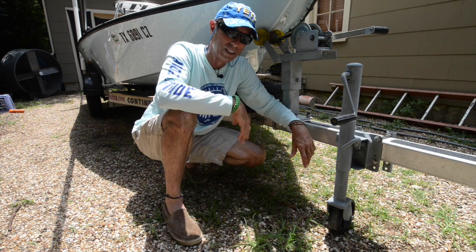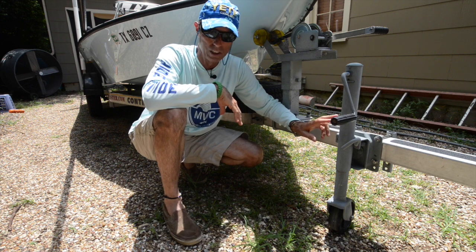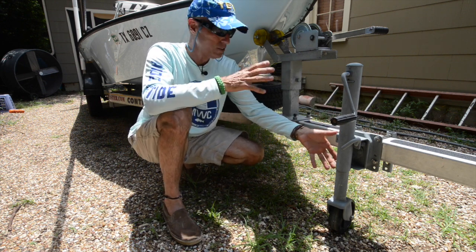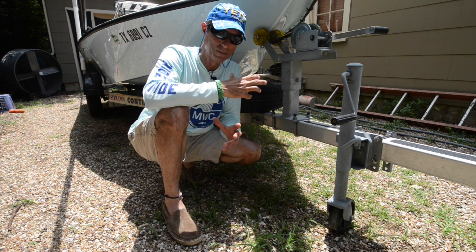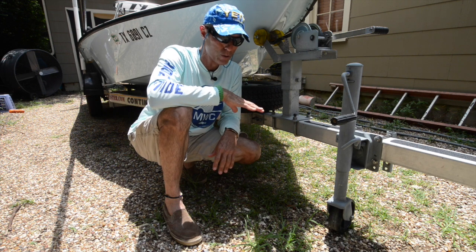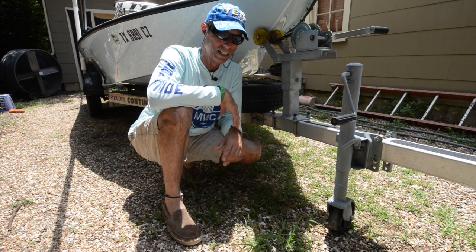This tube was too low, so it wouldn't actually fit on the trailer ball — I'd have to lift and drop the trailer onto the ball. I got tired of that, so I took the jack off, brought it to the machine shop, and had this bracket moved down the tube. These trailers aren't exactly built for skiffs — it's kind of an adaptation — and from the time I had it, it never worked right.